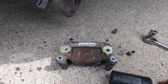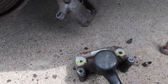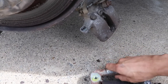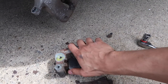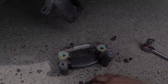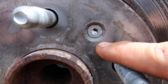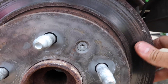I didn't take the pads out yet because it's easier when they're rusted in there — just take a hammer and hit them in. Don't hit on these pins; you want to keep that area smooth and clean so it can mate back up properly. Now all we have left is to take off the rotor and we'll have access to our wheel bearing. It's held on by a T30 Torx bit, so we'll unscrew that and then hammer the rotor off.